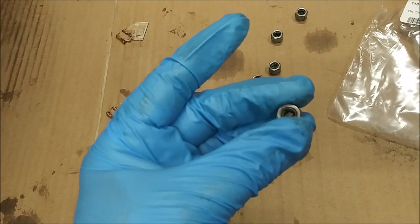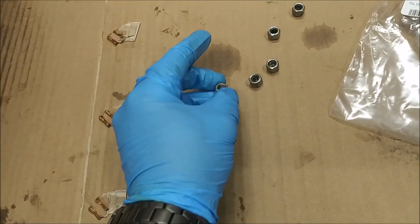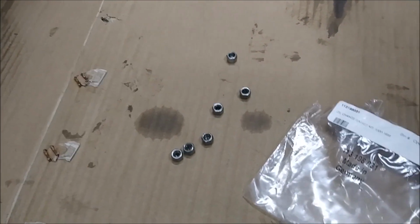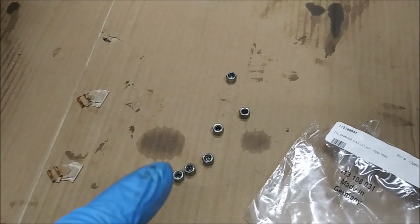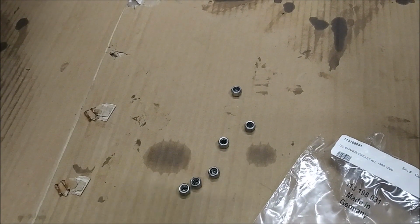And since they're caps and not just nuts that are all the way through, remember you shouldn't go completely crazy on the torque here. You need to go just enough so it doesn't leak. And what I do is I go just enough to where I think it's not going to leak, and then after every drive I get underneath the car and check, and if it looks like it leaked a little out of here, then I just torque a little more.